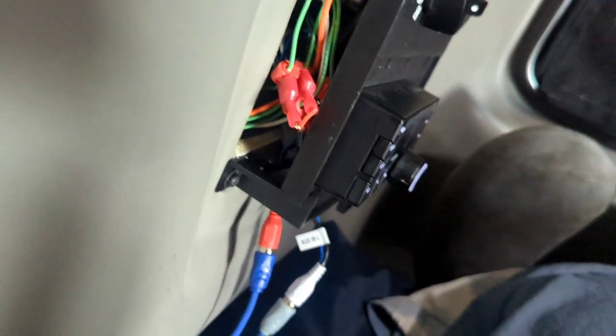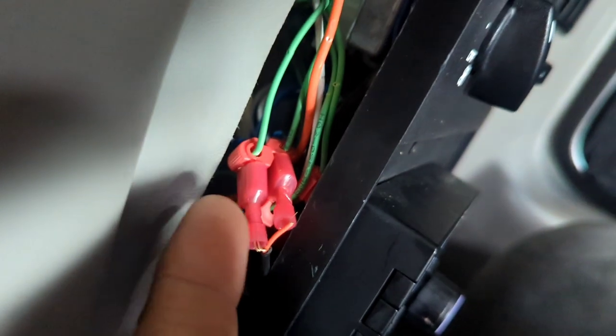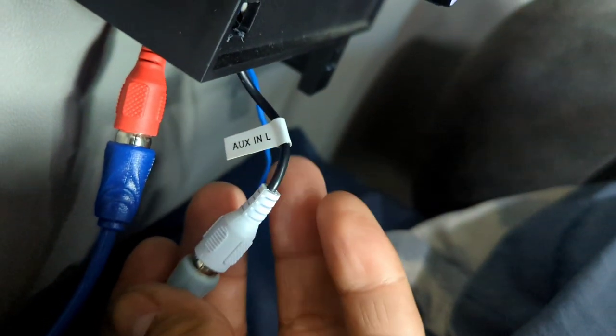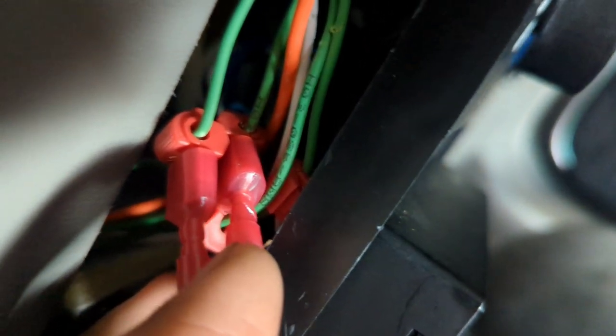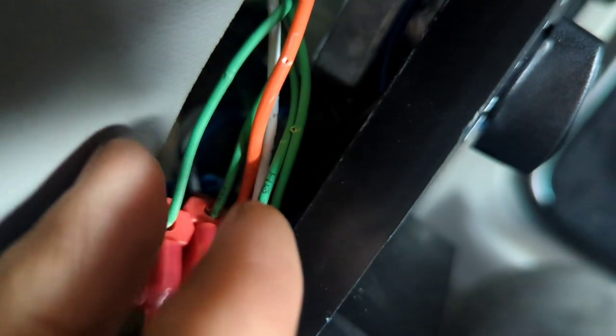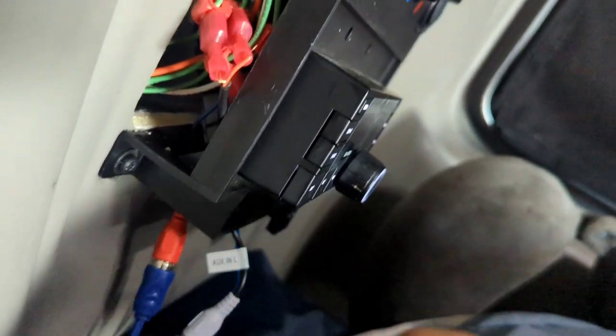In simple terms, if you're going to do a simple setup, you don't need to do all of what I did. All you need is just one cable. I put the same type of connector, and I had some leftover RCA from another project — just cut the tip. The shield is ground and the middle is positive. You connect it to those wires. The reason you don't need to do all four is because they sell a splitter at Walmart — just do one line, plug it in, and you get dual output.